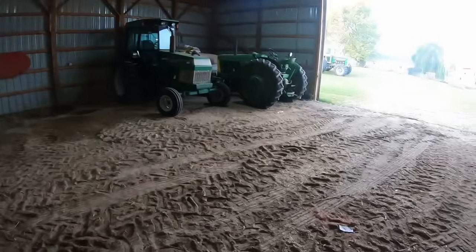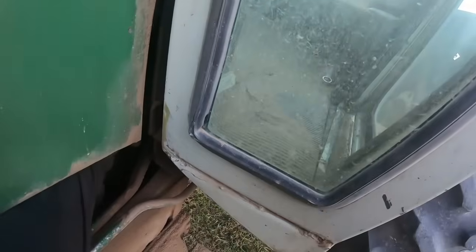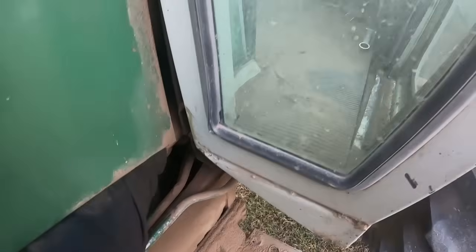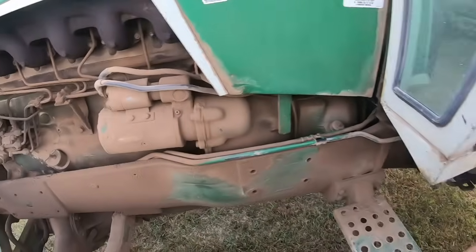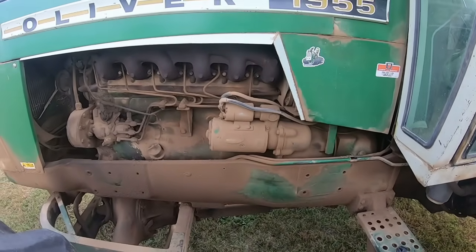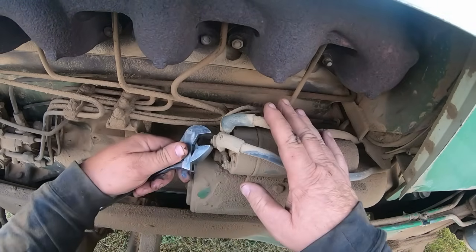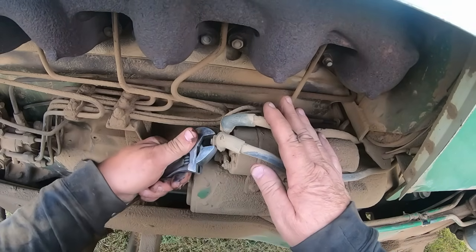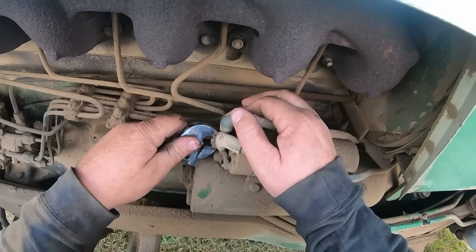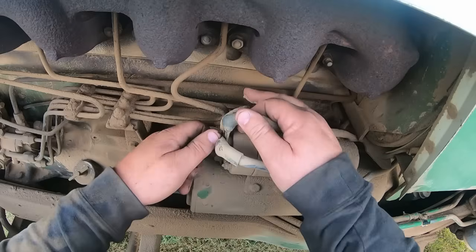Let's get to 1955 and where the 2155 was. Yeah, the first place I got smoke was down in this corner, and there's this yellow wire that comes around the corner there. There's the fan and the radio up there. And I'm betting that's what was going on. When I get done fixing it, it will have a fuse down lower. What I'm going to do now, battery's still disconnected, is, this obviously ain't the problem, or it would have kept on smoking without the key on.